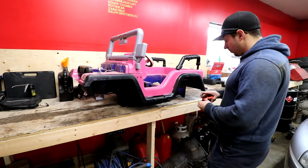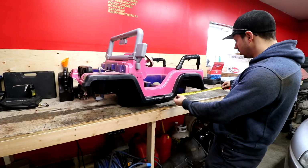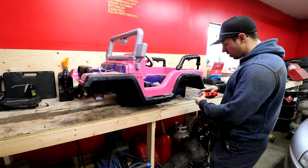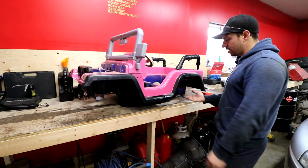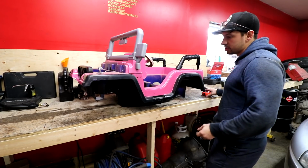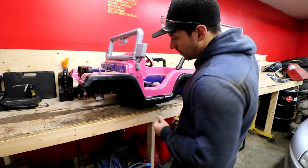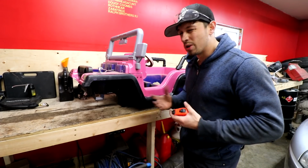So I was thinking the width of this fender is like 13.5 inches at the bottom here. And you probably can't tuck too much more in there, but I'm thinking like a 13-inch wheel. Because our frame is going to be static, there's not going to be any suspension movement. We can tuck it in as tight as we want, and then that's where it's going to stay. And then the same in the front. I think a 13 is going to be great. So we'll probably end up going with like a 6-inch rim and a 13-inch tire or a 12-inch tire, something like that.